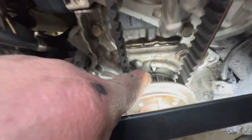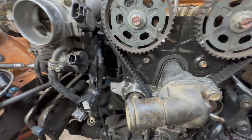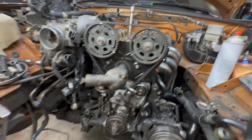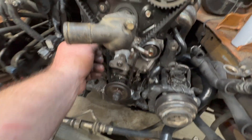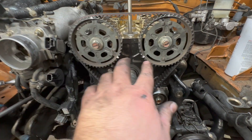So I'm a complete knucklehead - I didn't hit the record button. Let me show you what I did. Basically, I put the timing belt on and the crank pulley back on. I used white-out on the marks so you can see them - white-out here and here. They're lined up right there and you can see the marks. I put everything on besides this one piece, left the 14mm loose just hand tight so I could move it in and out. Zapped the other one down, put the belt on the bottom and ran it up through here and over the top. This one was off just a hair so I moved it down and it lined up perfectly.